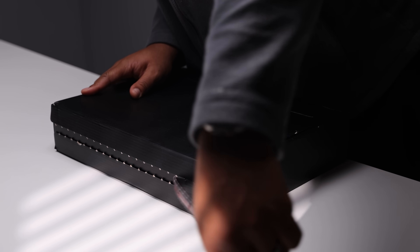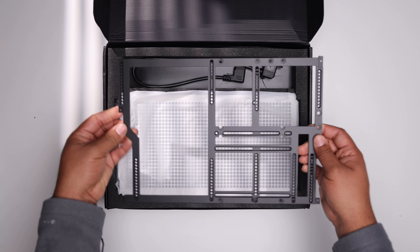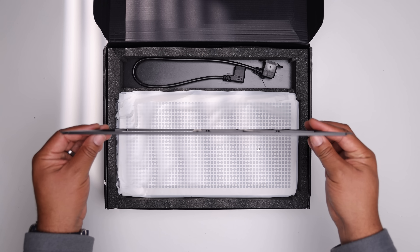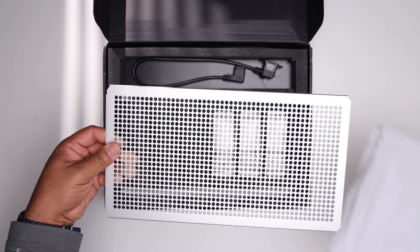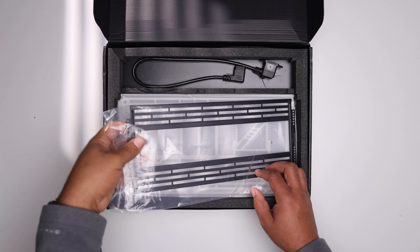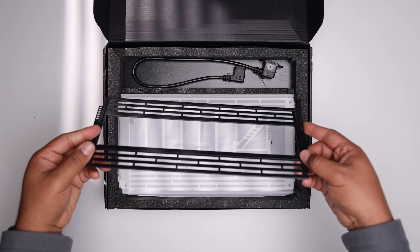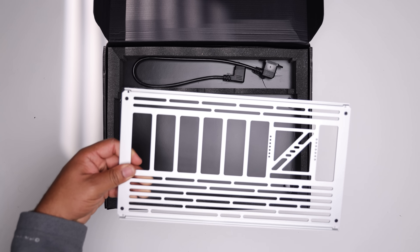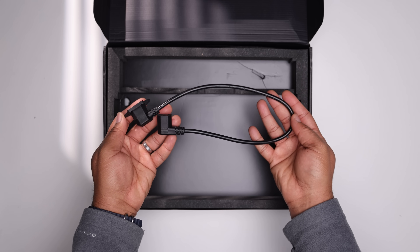Packaging is something In-Win does extremely well. Arriving in a black colored box, we get two black anodized side panels, the structural back plate that supports virtually all your components with multiple levels of adjustability for the motherboard and power supply, along with the ability to be flipped for the inverted setup option. The redesigned top panel with a new locking mechanism, when paired with the front panel, a top or side radiator bracket — unfortunately the kit only comes with one, so you'll need to purchase an extra if you want to mount fans or radiators on both the top and side. The bottom panel has space for up to two 140-millimeter fans.